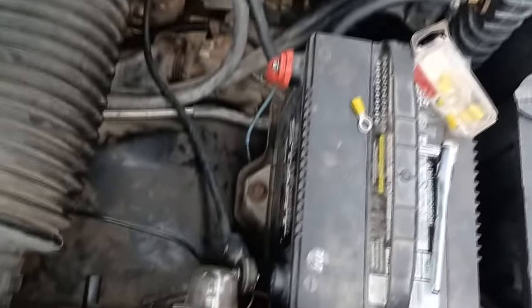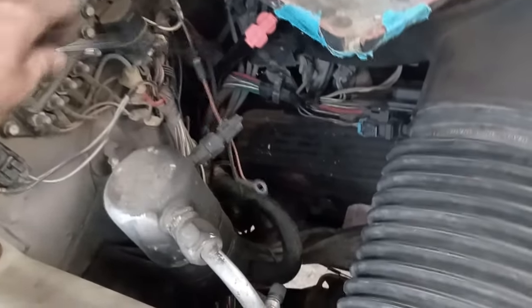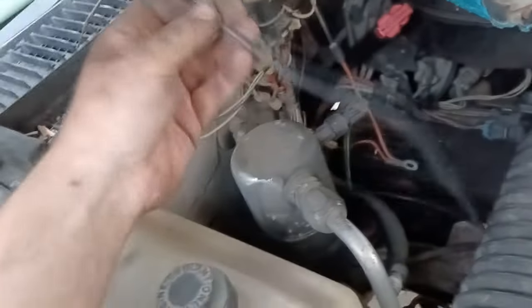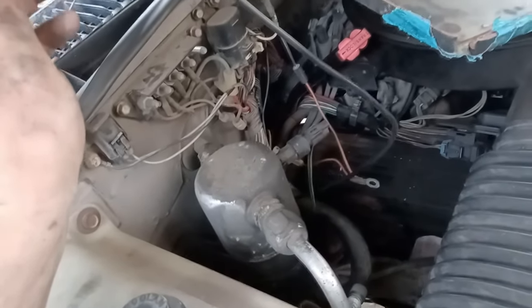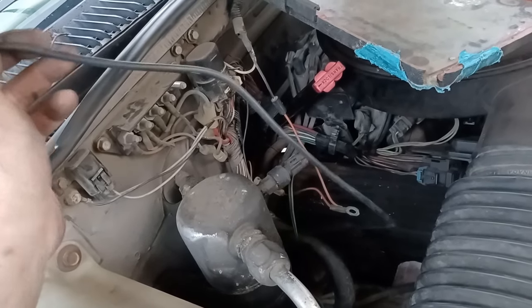Got it running under the battery tray. I'll zip tie to some stuff along the edge, going under the coolant tank, under the air compressor stuff that doesn't work. I'll zip tie it again to some more stuff and have it terminate up there. That keeps it basically entirely away from hot stuff during its whole run. I'll either find more real estate for the extra cable that I won't be using now that I have a shorter route, or I'll just clip it off.